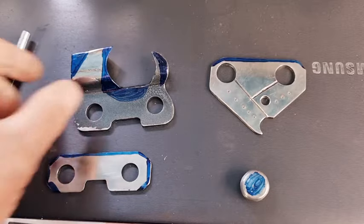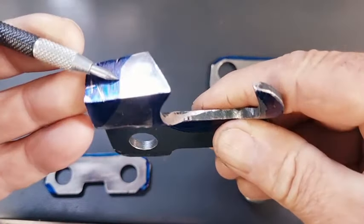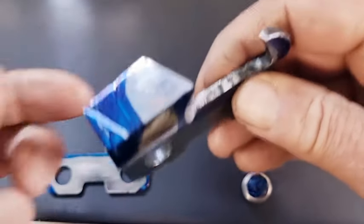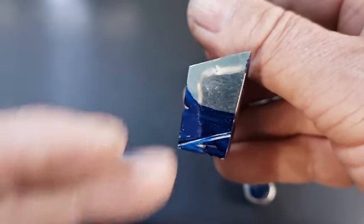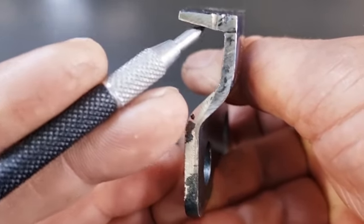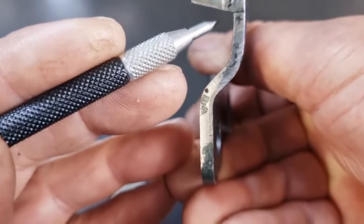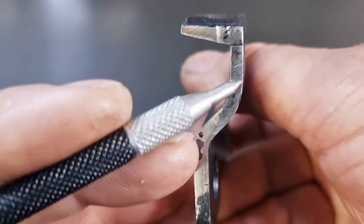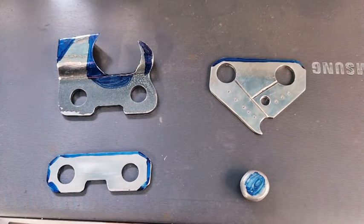The other thing is tunneling. On the top of the tooth, all this will be removed, and the corner can have material removed as well. Sometimes they might take half a millimeter off the tooth on the inside. What they do with tunneling is grind the inside of this a little bit, especially the corner — thinning this out. Normally on a tooth there's a little bit more metal there; they thin it out so there's less metal, like a hollowed-out profile.